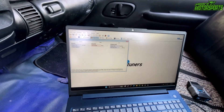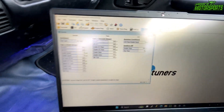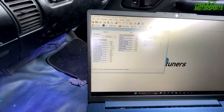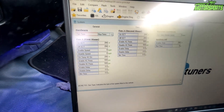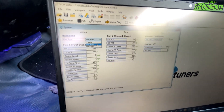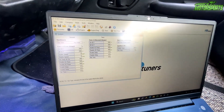Before we upload the file, go to System and click Fans if you plan on having electric fans. Right now it's set to no fans. Click Auxiliary Fans. If you plan on having two fans — one for AC, one for normal running — you'll click Two Fans. I usually just do the aux fan so you can run them both at the same time.